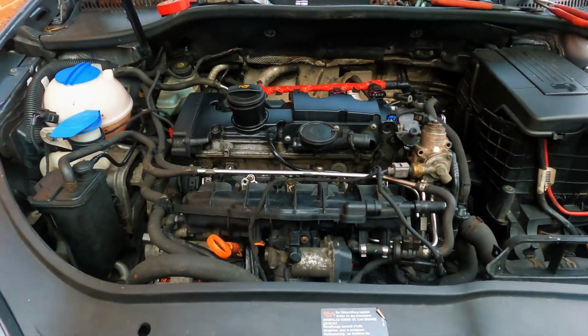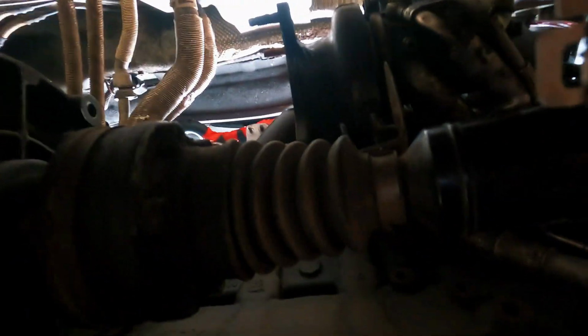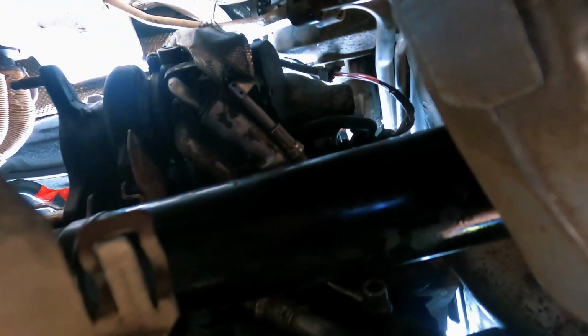I've buttoned everything up and I'm just ready to put the downpipe on. Right, I'm not sure what you can or cannot see, but I've got all new gaskets, all new crush washers, all the lines in the turbo are into the block, all the coolant lines, all the oil lines. So I'm literally ready just to slide up the downpipe, button that up, and I think everything then is done underneath the car. All the boost pipes are on.